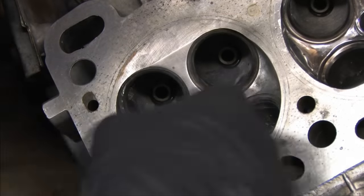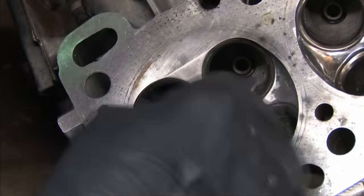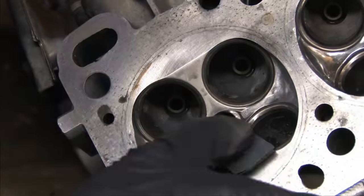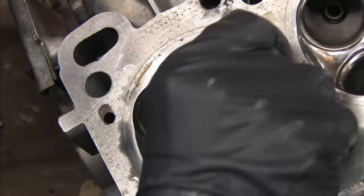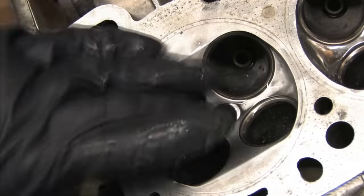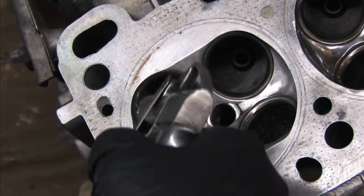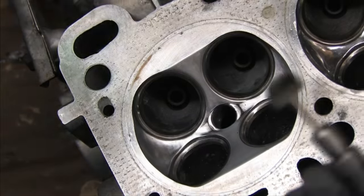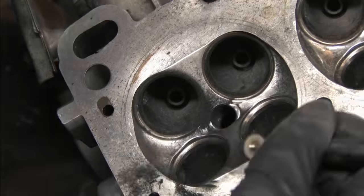This is fairly easy. It just takes water, sandpaper, a rotary tool, a little bit of black rouge, and a few different attachments for the rotary tool. If you've got 8 hours to kill and you own these tools already, then everything you see in this entire video will cost you less than $50 in consumable shop supplies. It's really not difficult at all unless you're one of those people who just can't sit still and keep your eyes on the prize. Polishing metal is really a very simple procedure. It's just a specific and a time-consuming one.